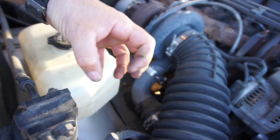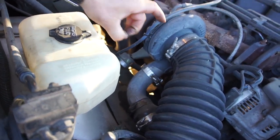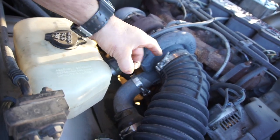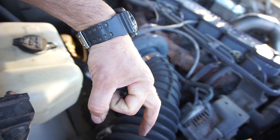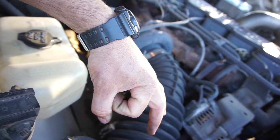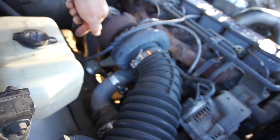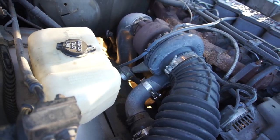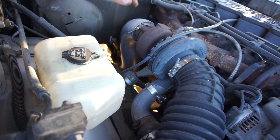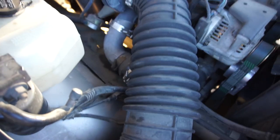It's kind of like a two-stroke pipe - two-stroke pipes go wide in the middle and then bottleneck really tight on the exit so they keep all that pressure in, and the back pressure goes back into the cylinder creating boost. That's what I think the problem is with his setup - the pipes are too big for the turbo.